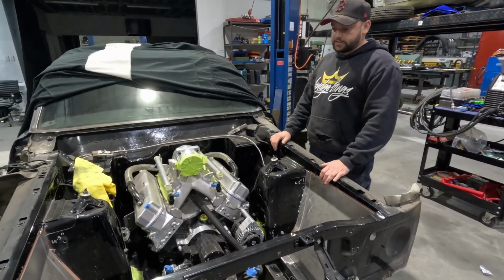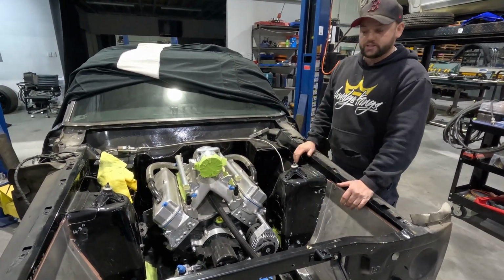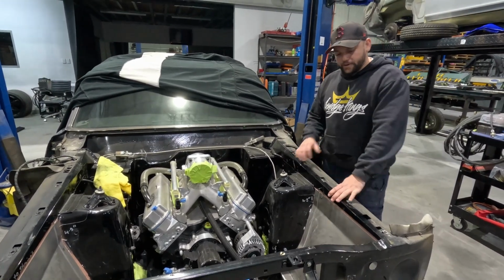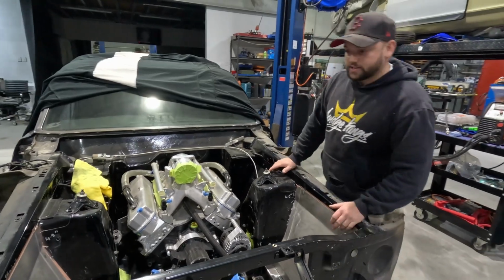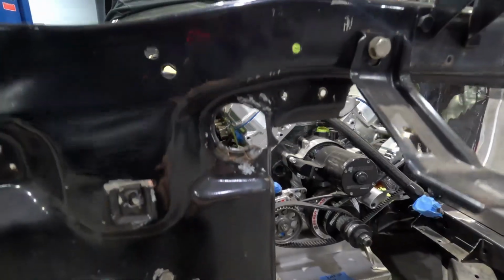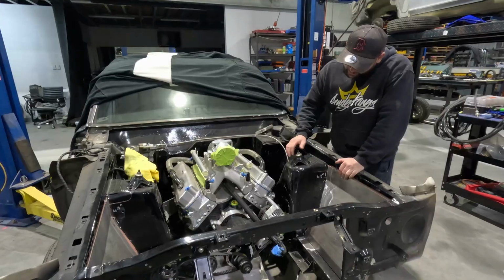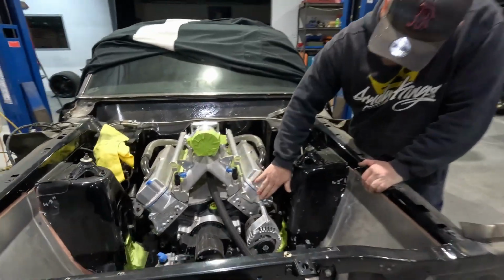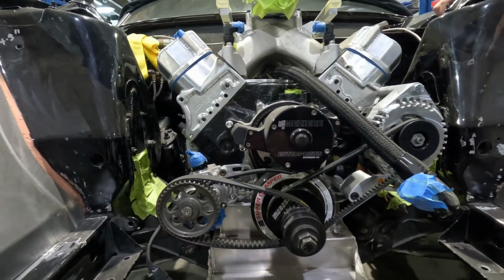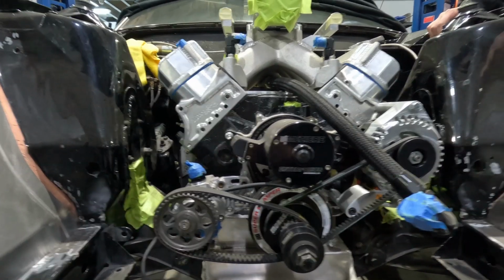Extractors, we're going to sit the collectors in, and then show you. We're going to have a Y piece coming up into the throttle body because it's not going to be intercooled. It's going to run on methanol the majority of the time. Along the way, we're going to be cleaning bits and pieces up. It's just some old crap here that needs to be changed. But yeah, this is a billet headed, next gen headed, I should say, Windsor, probably going to be knocking on the 2000s, which would be pretty cool. So this old girl will definitely get up and boogie.